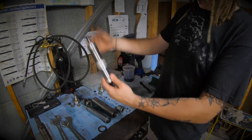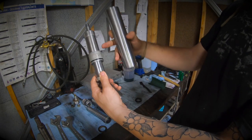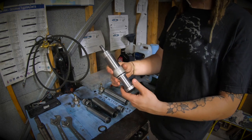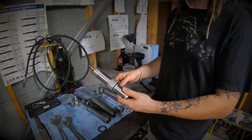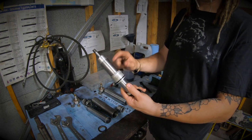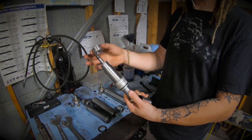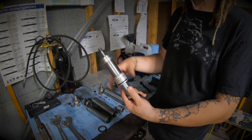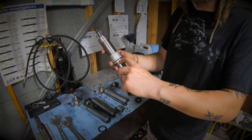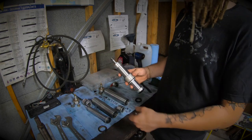Now when this is all back together inside the body, it'll be bottomed out like that and no longer allow the four inches of shaft that was coming out before - so now this will be an inch-and-a-half bump. Generally when you buy bump stops and order them from a company, whether four-inch, three-inch, or two-inch, they're generally all the exact same bump - it's just a matter of what size spacer they put in it. Some spacers are aluminum, some are steel. That's how you can make a spacer and change the adjustment on your bump stop stroke.